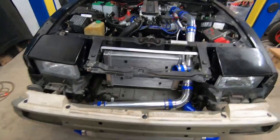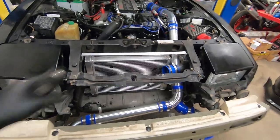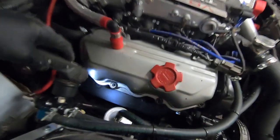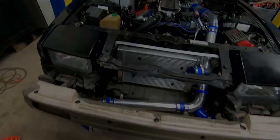All right, we got the front bumper cover off and I took the air filter portion of the intake out in order to get full access to the front area. First of all what we need to do is remove the oil filter. The oil filter is below this header right here — the manifold — and it is right there, so we need to remove that and install the adapter plate so we can connect the hoses and run them up towards the front and see exactly what we have to work with.